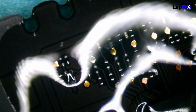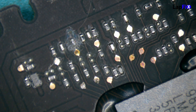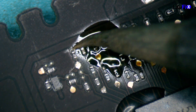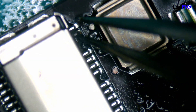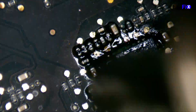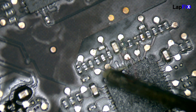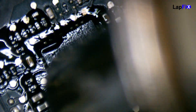We're going to clean off the capacitor and touch it up with our hot iron to make sure it makes a nice contact with the trace and pad underneath it. Sometimes liquid can break up that little connection, so we'll touch it up. We're going to do a similar thing with the SSD connection — just clean it off to make sure there's no extra corrosion impacting the pin there. Now let's go to our U7501 IC chip. It's always good to clean it first to expose the pins and see where the damage is, but this one has a little too much damage, so we'll definitely replace it.